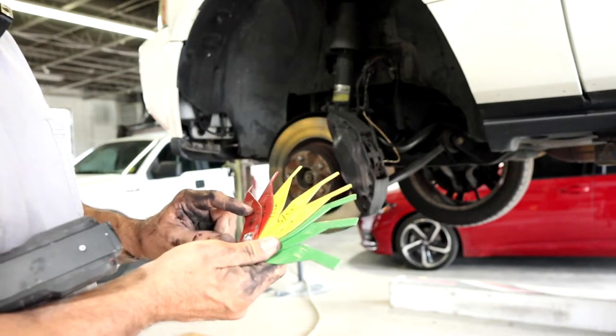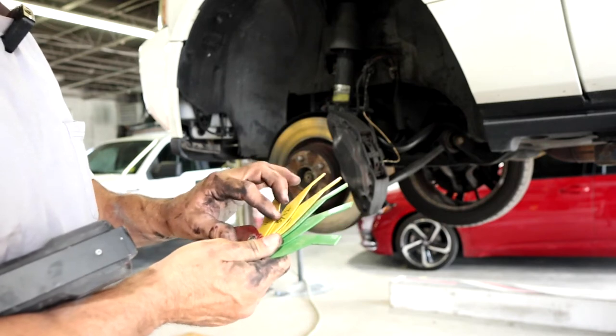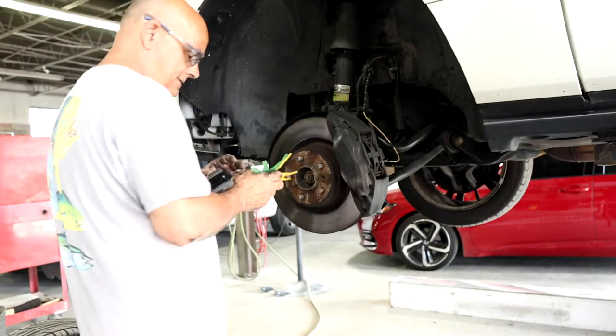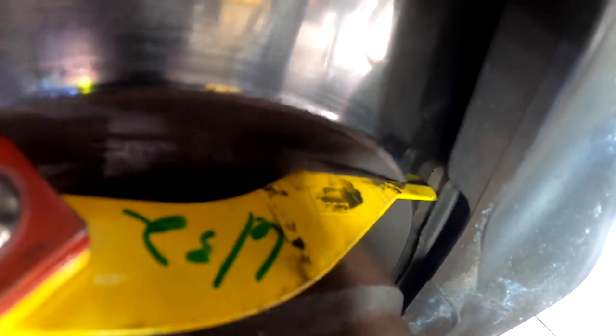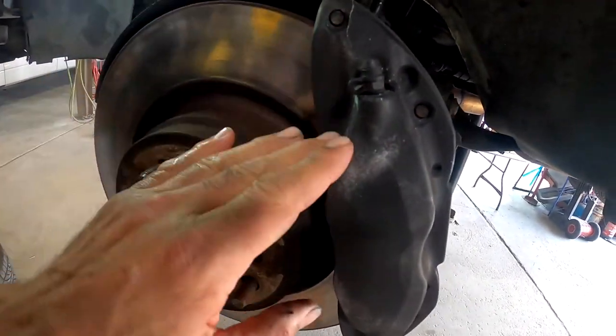If you're in the red, you've got 2, 3, 4, 5 thirty-seconds, and on up. So let's take a look and see what we got. They have more than 4 thirty-seconds on the pad — the gauge measures 6 thirty-seconds. That's plenty of pad. After checking the front brakes, we gauged them out. They look great, the rotors look good, the pads are plenty fat.